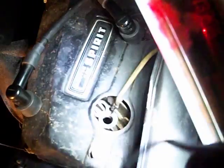Now that we have, I watched for fuel come out of our main hose here, which feeds the bowl. You can't see it too well, this hose is getting a little cloudy, but I watched fuel flow into the bowl, so it should be filled now. Now I'm going to put our spark plugs back in. If I could get this light to sit somewhere. NGK BR9ES.